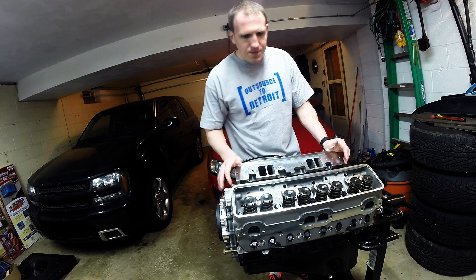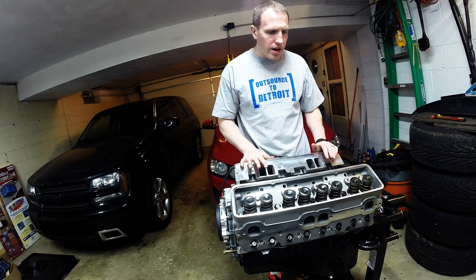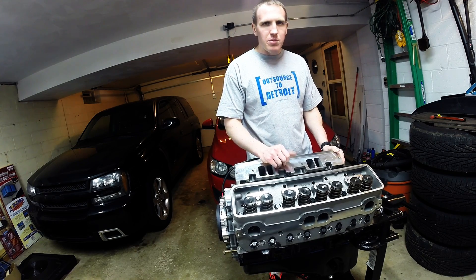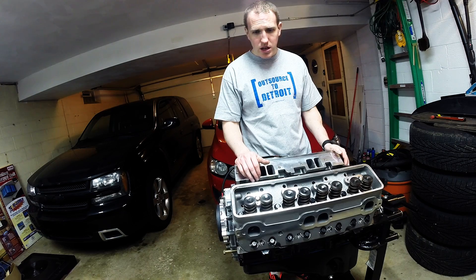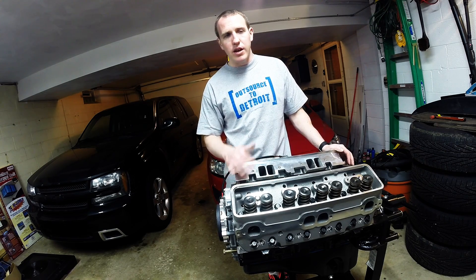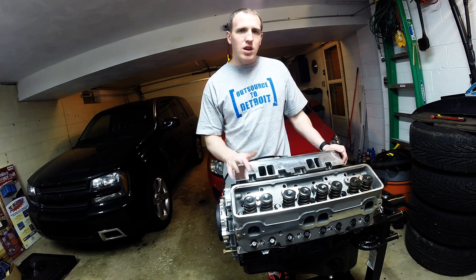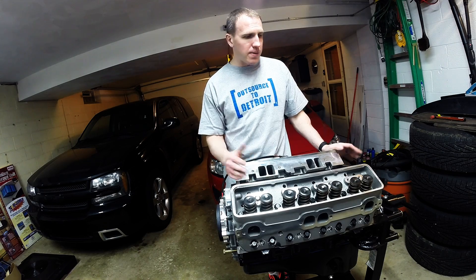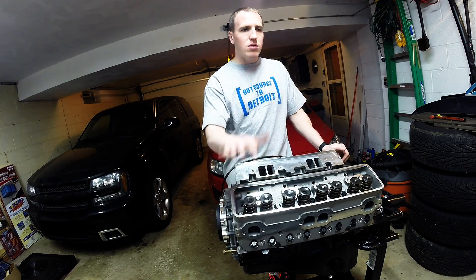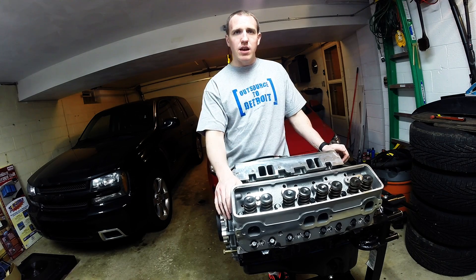Next step is all the stuff that bolts into the cylinder heads: rockers, push rods, retainers, all those pieces. Then I'm going to start doing other auxiliary items — water pump, headers will go on, and moving from there. This is kind of my first video on the Impala project — it's on hokiesgarage.com if you want to check it out. So that's pretty much it on this. Thanks for watching, I hope this was helpful. Give a like and a thumbs up, and let me know why in the comments if it wasn't. Cylinder head LT1 383 stroked by Golan V8, going into a '96 Impala SS. Thanks again, have a great day, we'll see you next time.